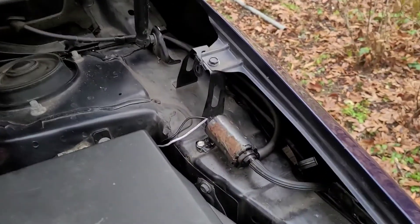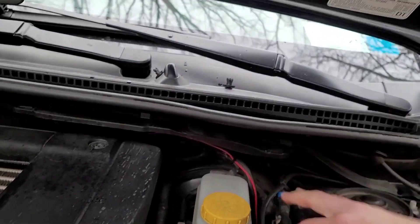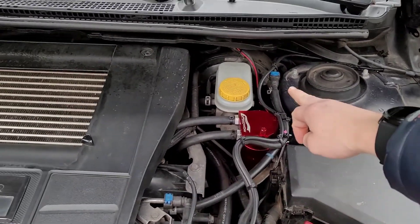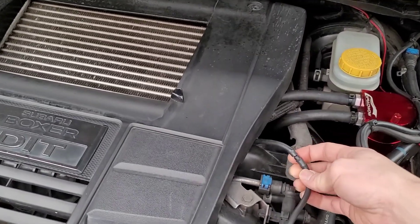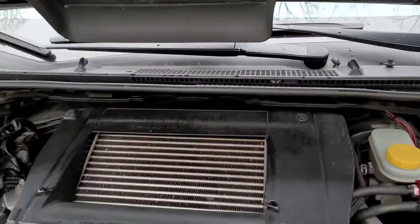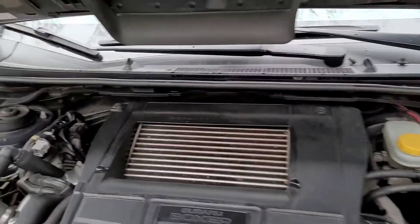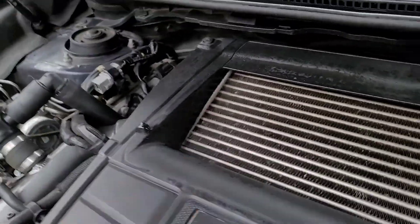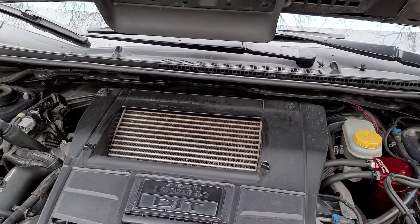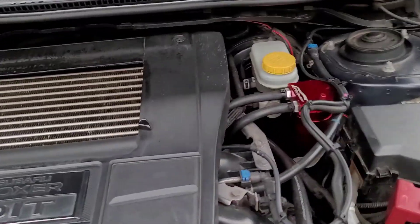On the discharge side, I ordered another hose and ran it this way, using zip ties to tie it off through and along the fuel lines. I made a quick-disconnect connection so I can detach it if I'm taking off the engine cover. The nozzles are connected to the engine cover — I drilled holes and the nozzles go through and screw in from the bottom, so you can reposition them however you want. Each nozzle has two sprayers and you can adjust each one up and down. These have a linear spray pattern rather than a mist, so I may change them in the future.